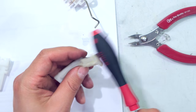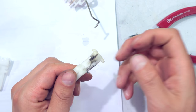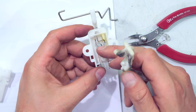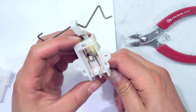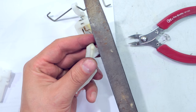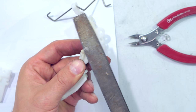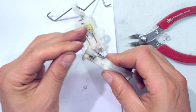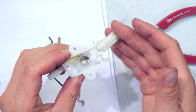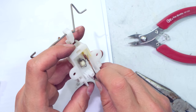Just demonstrating it's not going anywhere — it's strong. It's actually flipping hot, burning my fingers. Now I want to make sure it fits back into the switch housing. I'm checking it's smooth where it engages with the leaf spring — you don't want rough edges. If it were rough you could use a small file to smooth it out. Perfect — very little lateral movement. We're back in business and I can put the leaf springs back in.